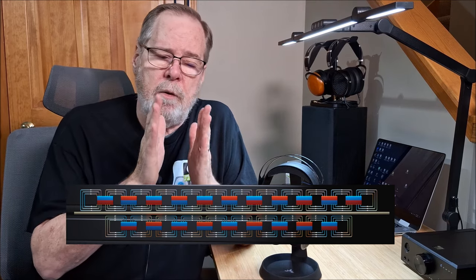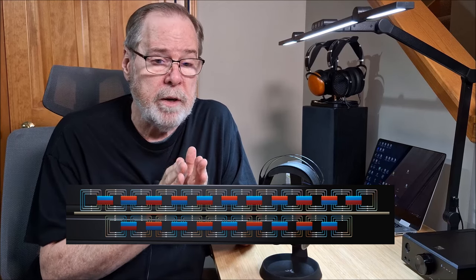In home speakers you see it all the time — they engineer new materials, aluminum, polypropylene, ridges and ribs to break up those distortions. With a planar magnetic, the whole diaphragm is driven. It's a six-micron thick film with an aluminum-silver voice coil etched onto it, so the entire surface of the diaphragm is driven simultaneously. There are no breakup modes. The diaphragm lives in a set of magnets — in the Phiaton's case, 20 neodymium magnets: 11 on the inside and 9 on the outside. Planar magnetics give you super low distortion, they're very fast, and they can be super detailed, airy, and wonderful on micro-details. I think planar magnetics do a better job than almost any dynamic headphone I've ever heard.